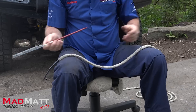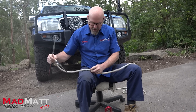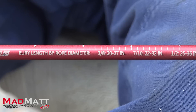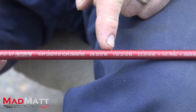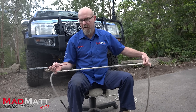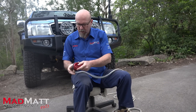Now we need to have the rope go through our splicer, and then we need a bury — which is where the rope disappears into the inner sheath. We need a bury of around 700 millimetres. The Fast-Fid has inches marked on it and it actually shows how much you bury depending on the diameter of your winch rope. But if you just work on 700 millimetres, that's going to cover you for the majority of standard ropes on a recreational four-wheel drive winch — that's 70 centimetres.